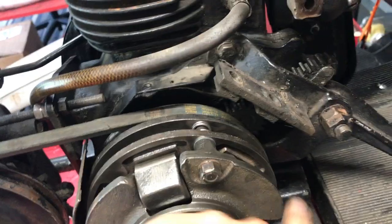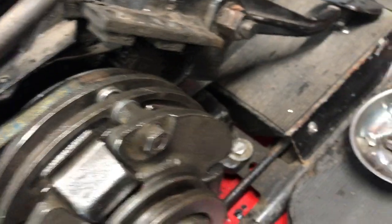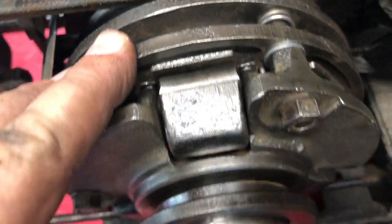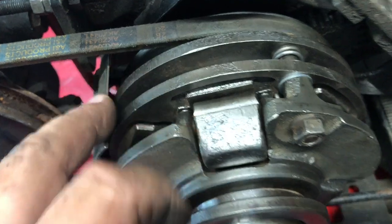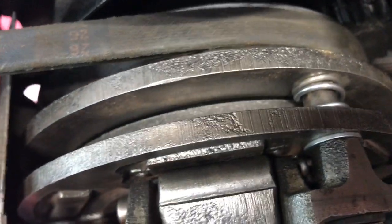As this thing spins, it's disengaged right now — you can see it's totally disengaged, not catching. We should have complete slippage. The clutch is slipping — it's turning but it's close. What happens is as it spins up, these weights drive in and force the plates together. Then when you step on that, it pushes in here and drives the plates apart just enough, and then you've got your spacers which keep your free play, so that when you're at idle it has slippage like that.